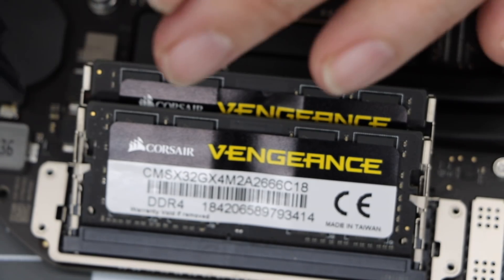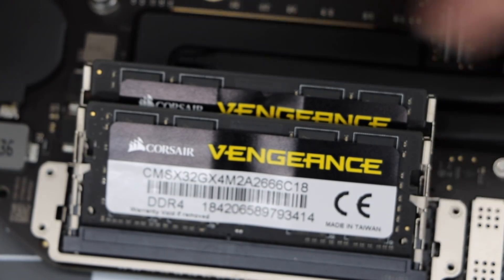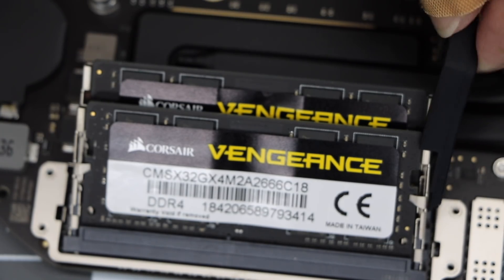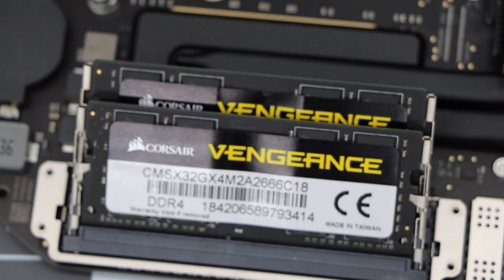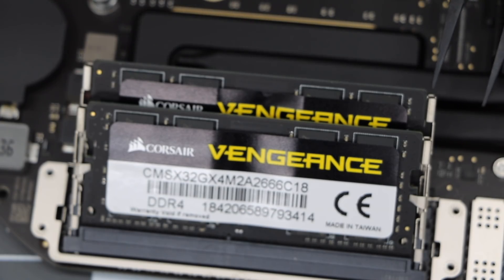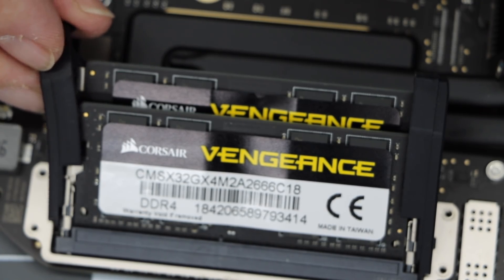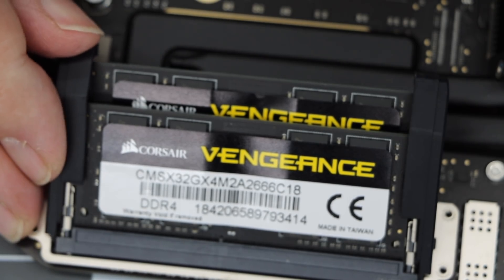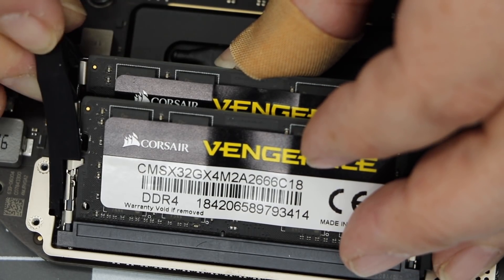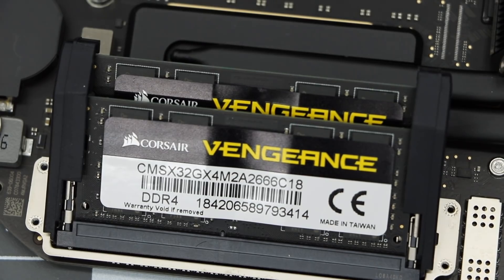So I have this stuff which is DDR4 — I picked it off Amazon. It looks like it goes in that way. Usually the way you set one of these is you get it in at the right angle like that and try to push it back. Make sure I'm in there right. That looks like it's in. You want the little tip to go in the little memory hole. You're pretty much feeling your way in, then pushing it back — really worried this is a bad idea — and it's in. This side has these little taggy things that correspond to the slots here.